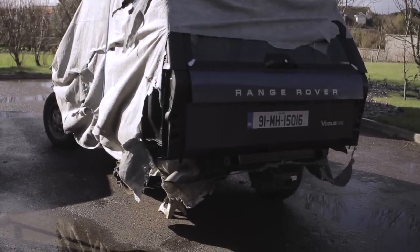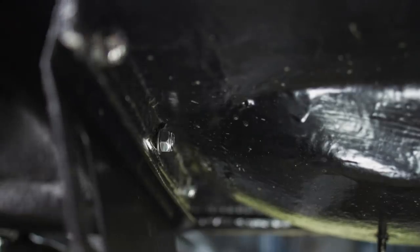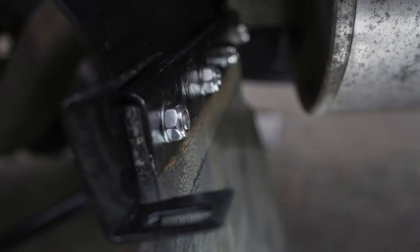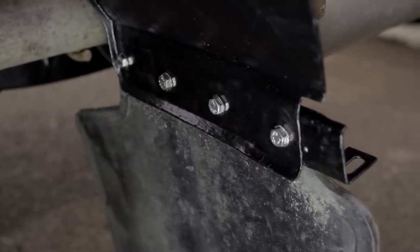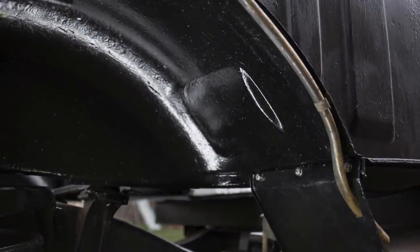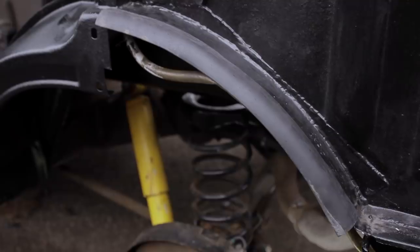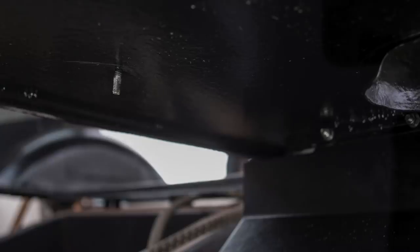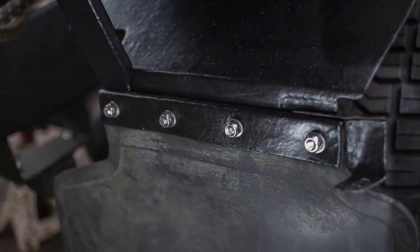It's looking kind of smart too. The next goal is to get the rear quarter panels on, but first we need to get the mud flap extensions on — they have little brackets that locate the lower ends of the rear quarter panels. Those go on no hassle. The sunroof drains are held by little clips running down the inner arch, and then over those there's a little rubber trim that makes a neat seal between the inner arch and the rear quarter panel itself. On the offside exactly the same. On both sides there are bracing bars that go on to reinforce those rear mud flap extensions.